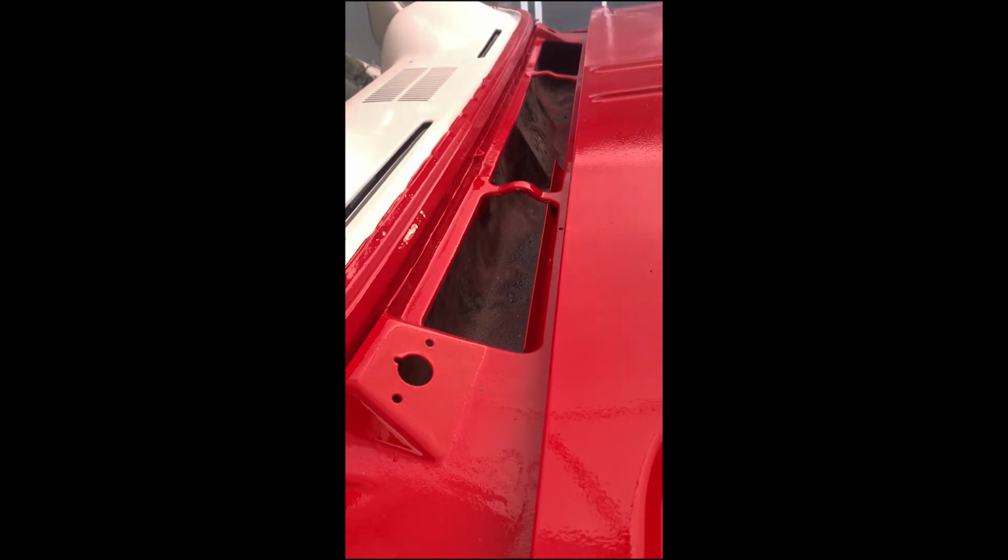It's insane, but you know what? With that Drizzle gun, it went great. Look at this. The orange peel is almost like factory, man. This is 3 coats of single stage performance red from Summit Racing. Got a little bit of dirt because, of course, like I said, it's blowing wind through like crazy, and all kinds of stuff is going through.